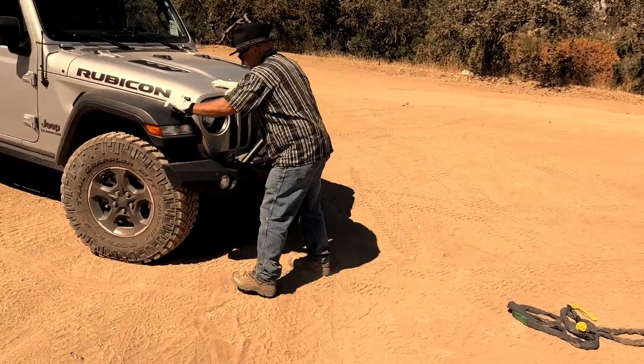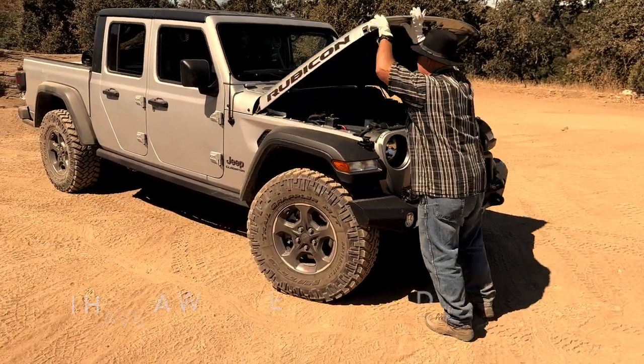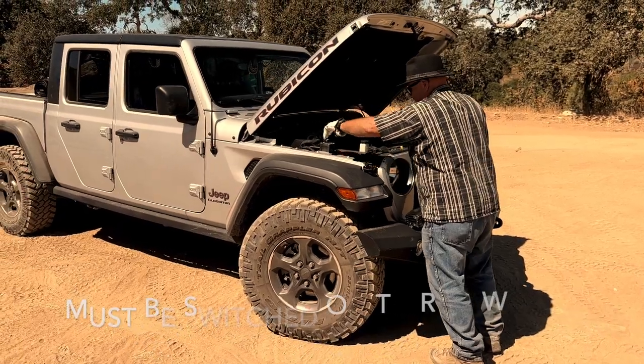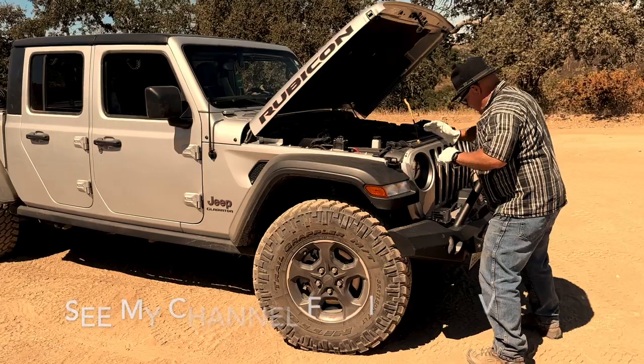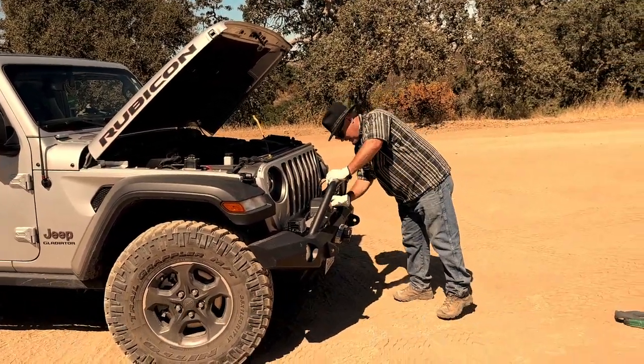I installed winch disconnect switches on both of my Jeeps, and you'll find a video of how to install that on my channel. I also like to have the hood open when I'm winching. If something does go flying, hopefully it wouldn't go through the windshield. It'll hit the open hood first.